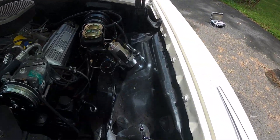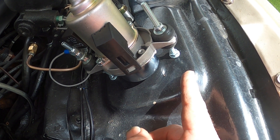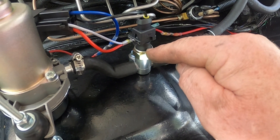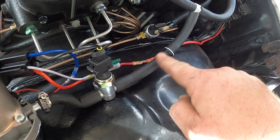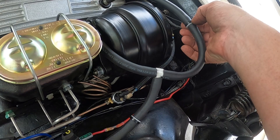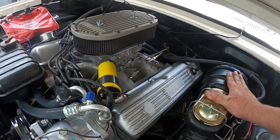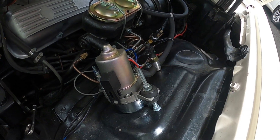We finally got out to the Galaxy to put the vacuum pump in. I put bolts through the fender well to keep the pump from touching underneath. My relay is mounted here, it's grounded. The motor is grounded here. Then we come over here to the vacuum switch — the vacuum switch activates the relay. The power wire runs inside to the ignition switch and is fused with a 30-amp fuse. Then we have another check valve, a T going to the booster, check valve T, and I put another check valve here. This should give him enough vacuum so he can drive the car. The 390 just isn't making enough vacuum — only about 14 inches — so we had to go for the pump. Here it is all installed and ready to go.